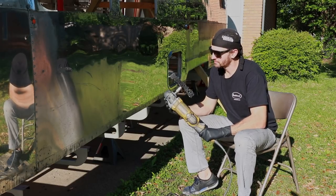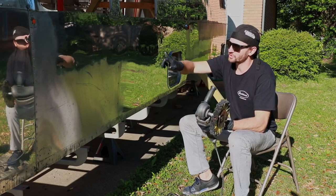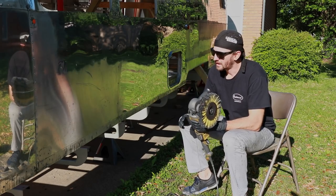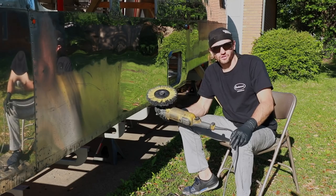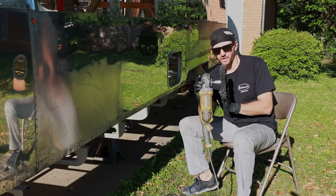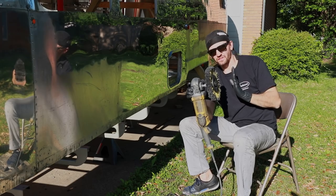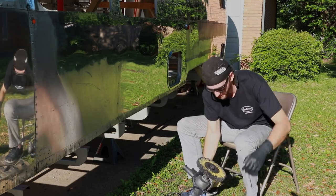This also is better for doing seams and creases and around where the rivet spots are. It also works well for using the cross-cutting technique, which I'll show you here in a minute. And we've got the safety flanges on it. When you're using the Airway, you want to use that, as well as the extension arbor, because that brings it out. You don't want this thing hitting your arm. I've done it and it hurts really bad.